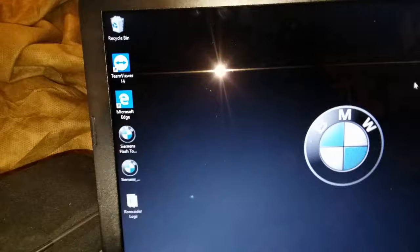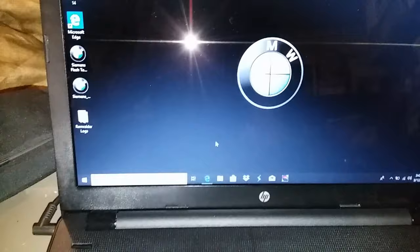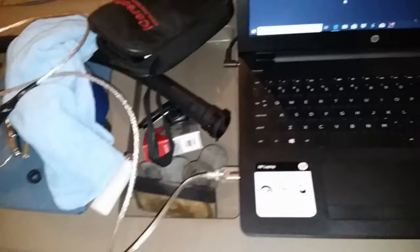So I'm actually going to flash the car now. I'm going to open my Facebook and download the file he sent me. We also have an INPA cable, and I have this marked right here — that's because this cable is mated to this port only, so I must use this port every time. I have it taped to make it sturdy because it was acting weird and kept making the device disconnected sound, so I just stiffened it up and haven't had a problem since.